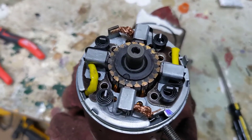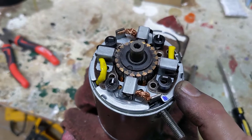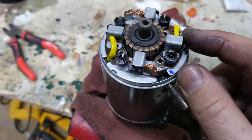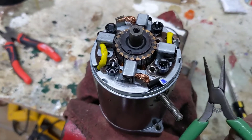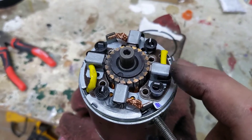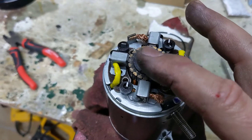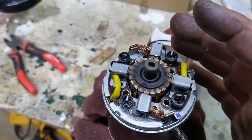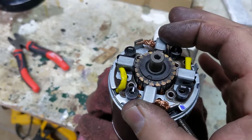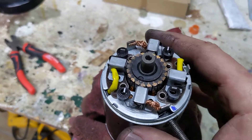Aside from the O-rings, we just went ahead and moved forward and put this new brush plate in place. It's a little tricky to do, to be honest. I took the springs out with a pair of small needle nose pliers and pulled them back about 90 degrees on all of them, put the brushes in, and then you put the armature in the middle. Then you've got to work it up — it's a little tedious — but you've got to get all these brushes back out of the way for that to go into place, and then you can twist back in your springs for your brushes. And that's where we are now.